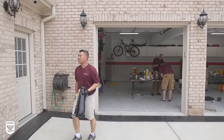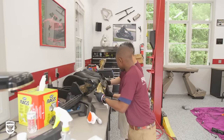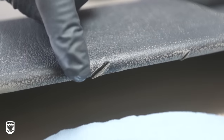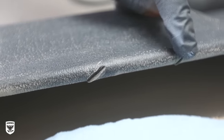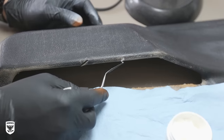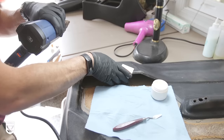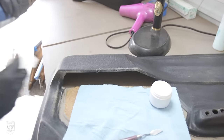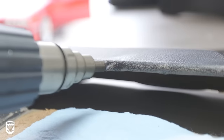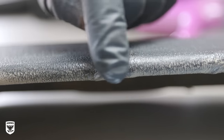Once everything is prepped, the parts that need to be repaired are brought over to the other side of the shop, where Patrick and Brian are filling in any tears, holes, or cuts in the vinyl before dyeing. The door pocket has a gash requiring a special repair procedure for vinyl — the paste is applied and heated up, then textured, then reapplied, heated, and textured again until it fills the gap as desired. Much the same concept as bondo and paint repair, but this is not bondo, so don't try that on your interior.